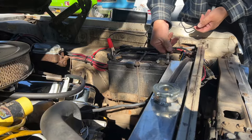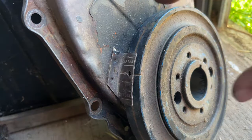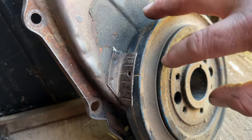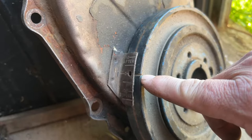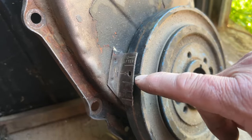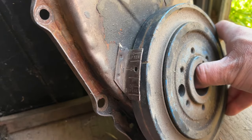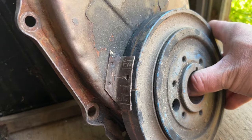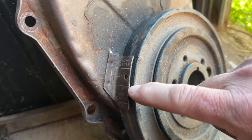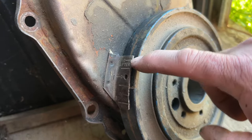As the engine's running it's gonna flash a light. We're gonna start off talking about a normal timing light, a regular old-school timing light. As the engine's running you're gonna see the timing mark appear. If this was where you saw it appear, you're basically at top dead center. Anything on this side of the mark is going to be retarded and anything before it's going to be advanced. So we've got 5 degrees advanced, 10 degrees, and 15. And on this side you've got 5 and 10.